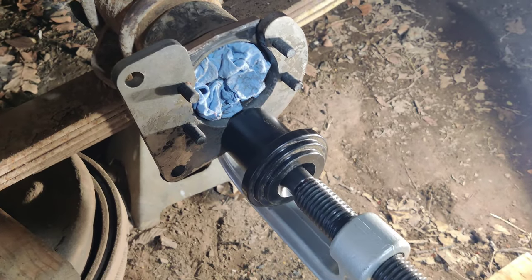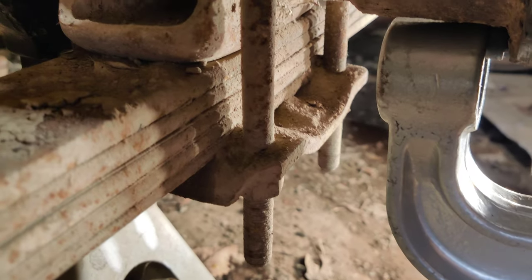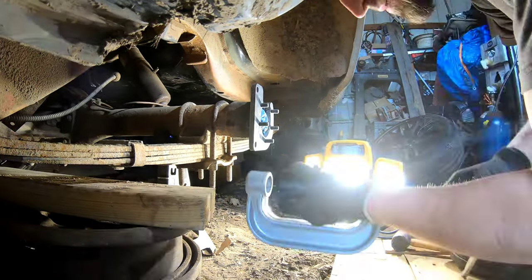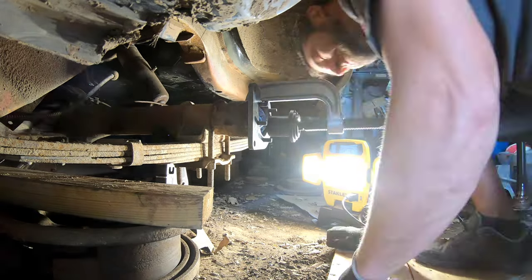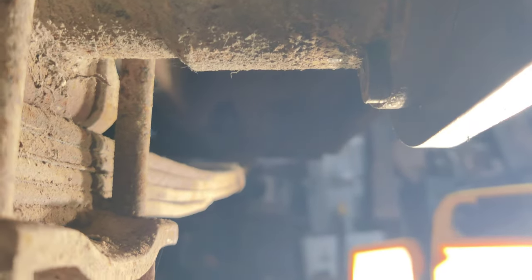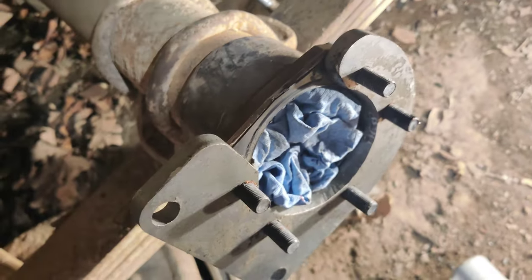Maybe a little janky, it's a ball joint press, but it's made for stuff a lot stronger than these studs you haven't pressed in, because there's just not a whole lot of room for using the hammer back there. Let's see if we can get that to work. I gotta say, that worked wonders. Bottom stud, pressed it nice and smooth. So I'm gonna go ahead and do it for this top one. I did put on this thicker plate just to keep it from deforming the gasket that's still there, but also just to give it some extra strength and rigidity because that plate's pretty thick.